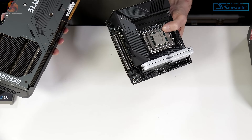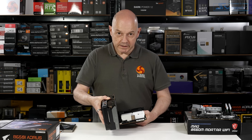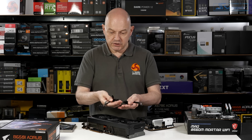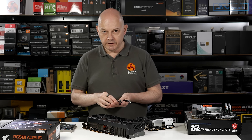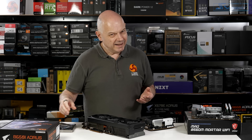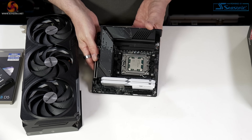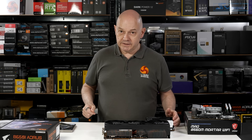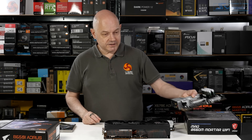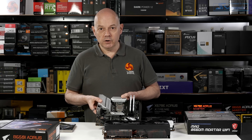With the Gigabyte B650i, the graphics card is practically larger than the motherboard — it's overshadowing the end of the board, but there's nothing there apart from the graphics slot. That's part of the reason Gigabyte offloads connections to those dongles. The board itself is very small, but by the time you install all the required hardware, it doesn't really end up as compact as the 170mm x 170mm form factor suggests. I like Mini-ITX, but Micro-ATX has a huge amount to recommend itself in terms of ease of installation and price.